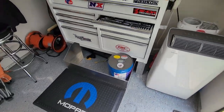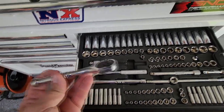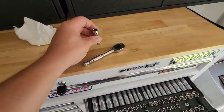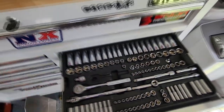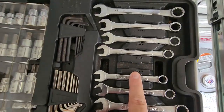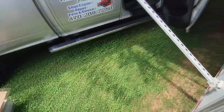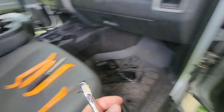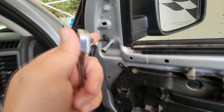For tools, we're going to use a quarter-inch ratchet and a 10-millimeter deep well socket - that's what I'm using to remove the nuts and install the new mirror. A basic socket set should get you by. Worst case you can probably just use a wrench - and of course what's missing is the 10 millimeter, as always. That's pretty much it - nothing crazy needed. So your 10mm, a Torx screwdriver, a Phillips, and the tools they give you and you can knock this out.